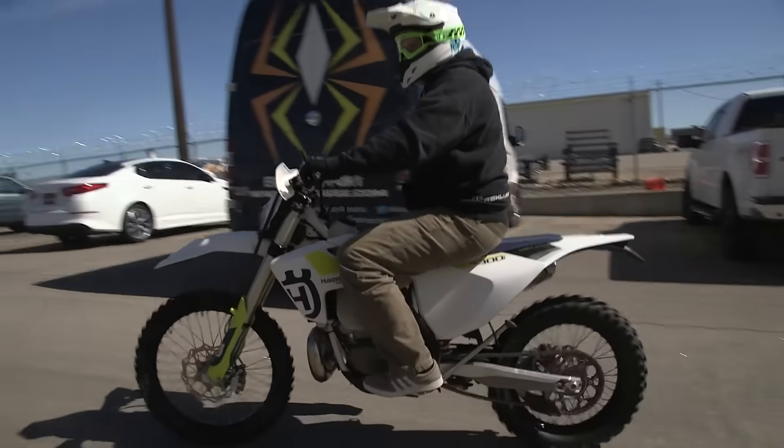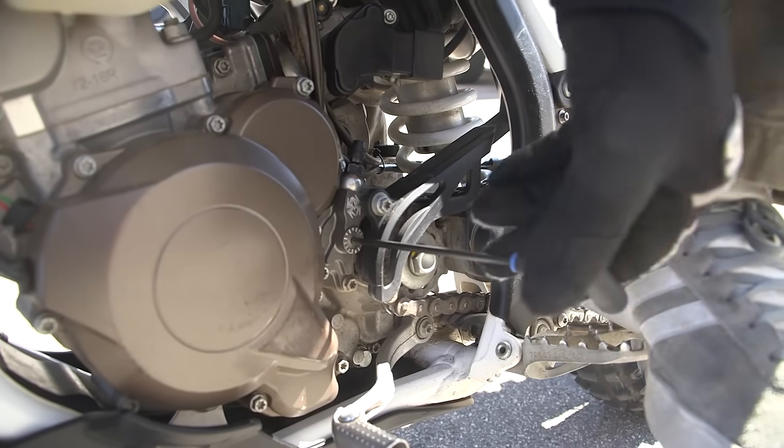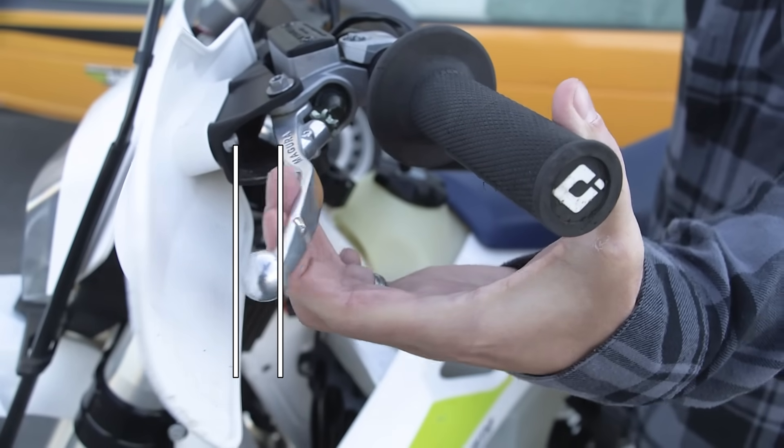You can then select neutral before coming to a stop, adjust the slave cylinder back to its original position, recheck free play gain, and you are back to riding again.